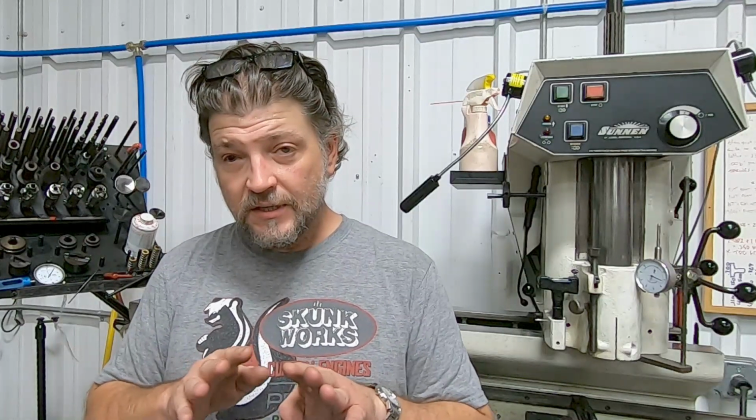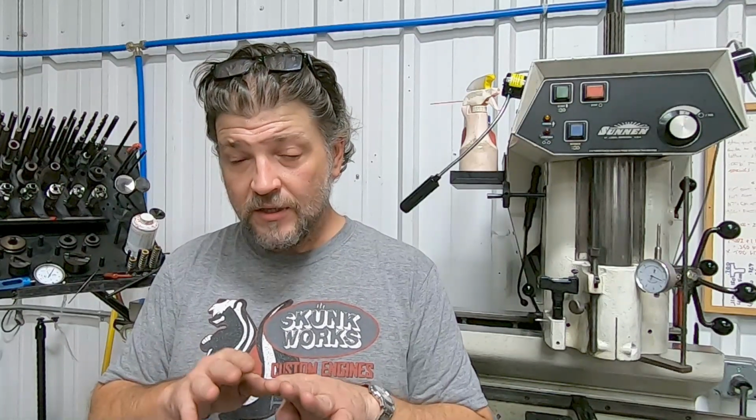So Paul has turned that cylinder over to his friend, who is confident that he'll be able to get into that liner and/or the cylinder wall there, grind into it a bit, weld those cracks up, and then, you know, braze that hole, then be able to refinish it.